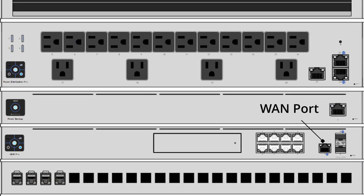In the future, when fiber is available, this can be upgraded to as high as 10 gigabits a second. A lot of ISP-provided modems are also Wi-Fi routers and switches, and that's great if you want an all-in-one device, but we have our own routers and switches, so this will be configured in gateway-only mode. Gateway-only mode bypasses the routing and switching functionality and just passes the traffic straight through. The modem connects to the WAN port of our Dream Machine Pro — the ethernet WAN port for now, but if we get fiber we can utilize the SFP WAN port.